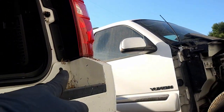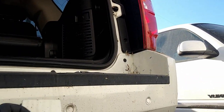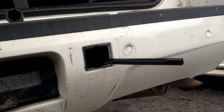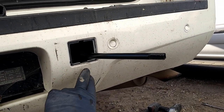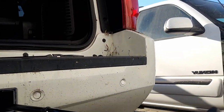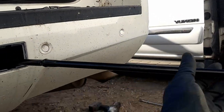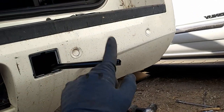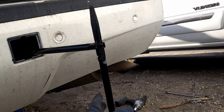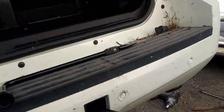To remove the spare tire, you just use your regular key - pop it out from the bottom. You'll push up the tab right there. You can use your key to squeeze in between the bottom and pull it right out. Use your key to take off that lock, and then your tools right here. You'll need two pieces. Now that we're on the same page - I have the spare tire to the side. You can take it off, it will make things a lot easier.